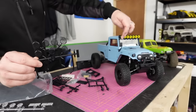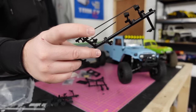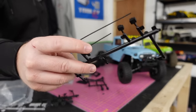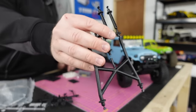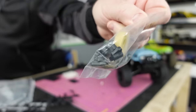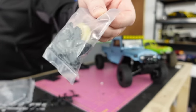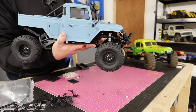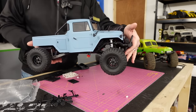You've got guards that you can put on your spotlights across the top — that looks really good. That looks like a big aerial and then maybe a little aerial. That gives you the option of running your servo and a winch. Body post if you want to put a different body on. You've got a load of rod ends in there. You've got your optional overdrive — I think that might be 11%; it comes with five point something and that's like 11 point something in there. Overdrive means that your front wheels turn more than your rear wheels, helps when you're climbing to pull the front end down a little bit, and also helps pull the front round when you're turning.